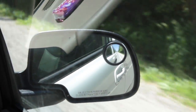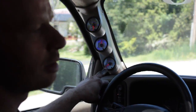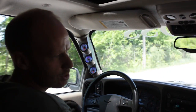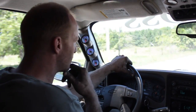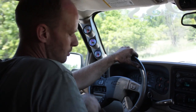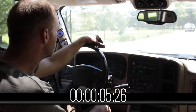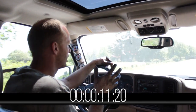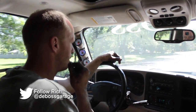Getting up to about 10 psi, a little bit of black smoke but nothing like it was before. Getting up to right around 20 psi — it starts vibrating. The gauge was showing zero boost when revving in park, but I can see my boots ballooning so I'm not 100% sure I trust that gauge. We'll do a zero to 80 — three, two, one, go. Still a big cloud of black smoke just when I first started off, so I can back the aneroid off a bit more. I can turn the fuel pin up another turn and see what the difference is.